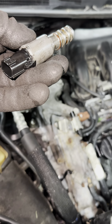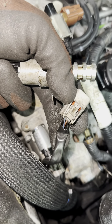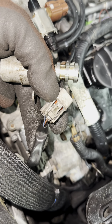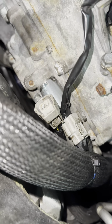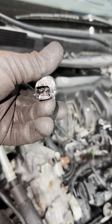The problem was when I pulled the wiring diagram: the brown and blue wires should be the exhaust solenoid, and the yellow and blue is the intake. But the yellow and blue was connected to the exhaust — the previous mechanic swapped those connectors because both connectors are the same and you can fit either the intake or the exhaust.